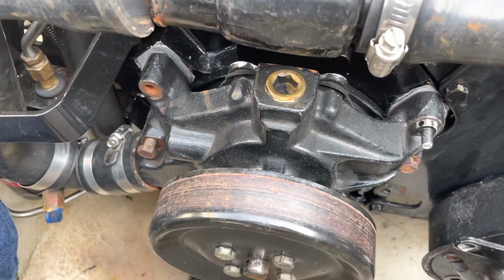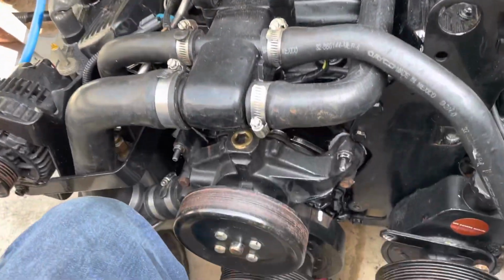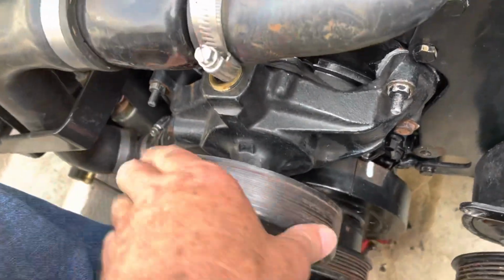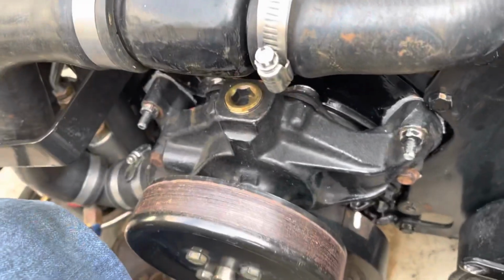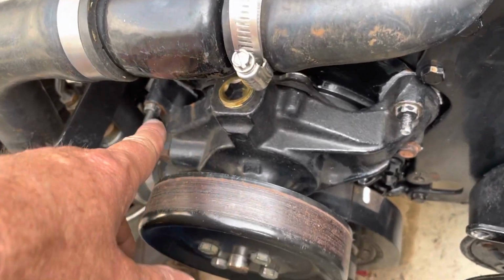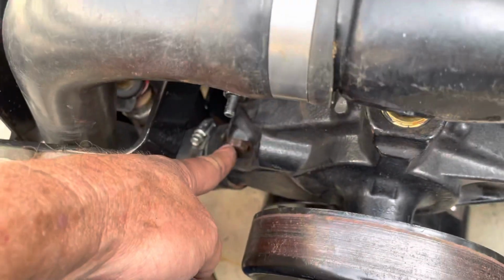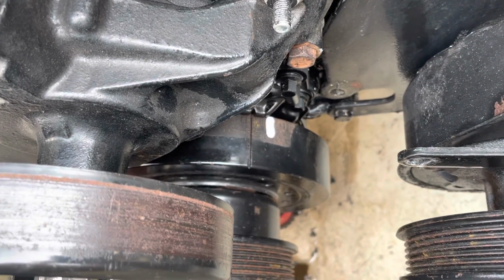The gaskets are installed. Both sides have gray silicone sealant. All right, the new, improved water pump is installed. No more squeaking, real smooth. Got gray silicone sealant on all the bolts, 4 bolts. The 2 with studs on them are on the top, and then the long one goes there, and the medium one goes there. Water pump's installed. I have a white mark on my timing mark now.